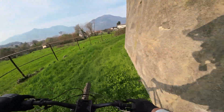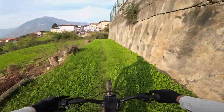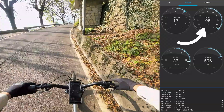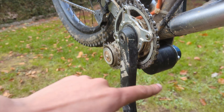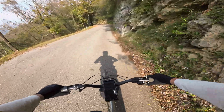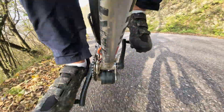Right away I noticed amazing power, but when limiting it to 450 watts it presented quite a bit of high-pitched noise, indicating the motor wasn't working optimally. Checking the real-time data, I noticed the motor couldn't keep up with my pedaling cadence, resulting in the motor constantly running at around 100% duty cycle — far from the ideal 80%. This meant the reduction was too high, making the motor physically unable to spin faster than I was pedaling, cutting assist at around 70 RPM at the cranks, which isn't much considering the standard cadence is between 60 and 90 RPM.